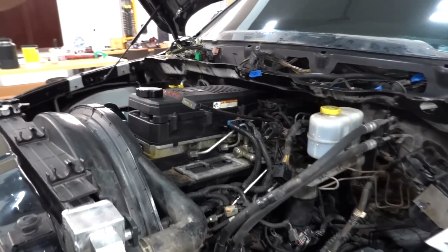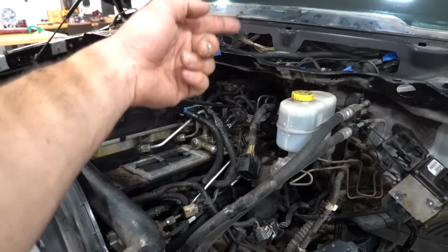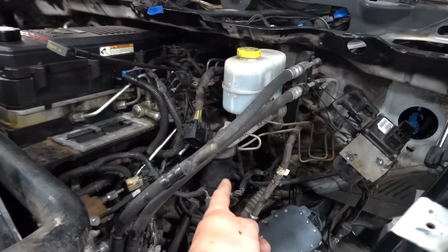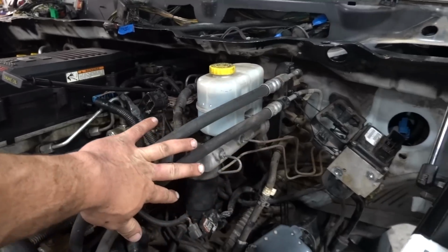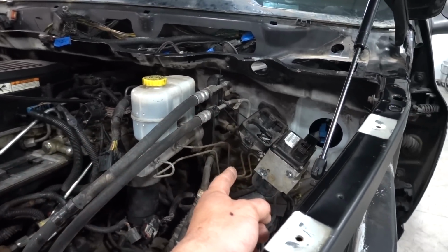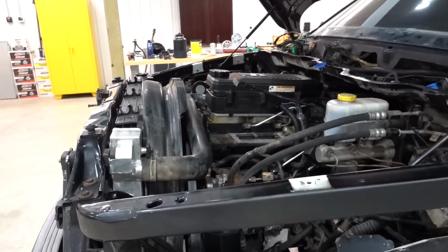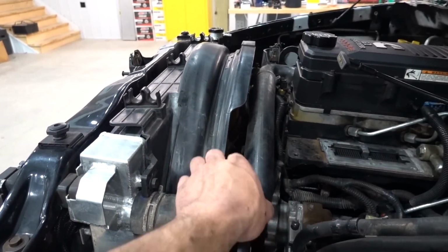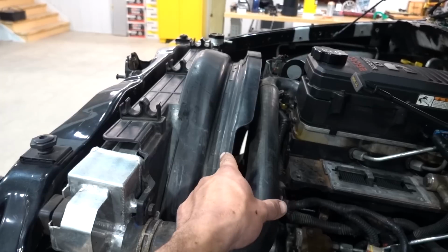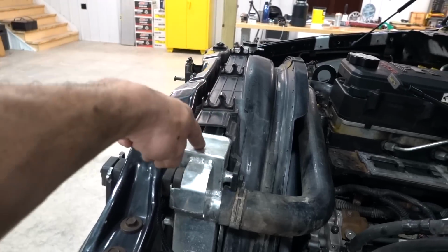So we've got a different valve cover. We're going to be changing this plate here, which means when you take off the fuel system, our factory fuel filter isn't going to be here. We're actually going to reroute these power steering lines. We're going to ditch our ABS pump like we did on the 05. We are going to rob some parts that the 05 used to use that aren't being used anymore, like the A2 race upper coolant pipe. We've got a set of electric fans, and we're going to keep the Mishimoto radiator.